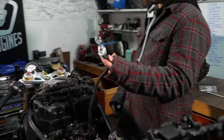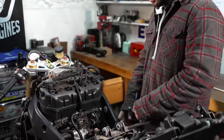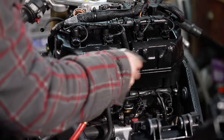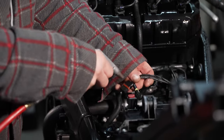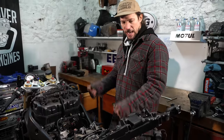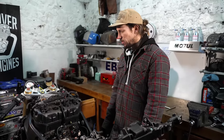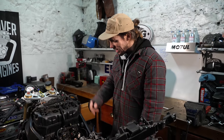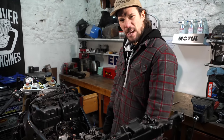To do that I need to make sure I'm not putting water anywhere it shouldn't be. I've secured the end of the fuel pipe with a zip-tied bag over it so I can't get any water down the fuel line. Then as I finish cleaning I'll blast all the connectors with a little air line to make sure the water's cleared out of everywhere. Big heater next to it, dehumidifier, and just make sure it dries out properly so we don't get any corrosion problems — I think that's going to be the best way to get this thing actually looking nice again.